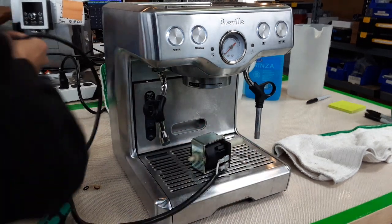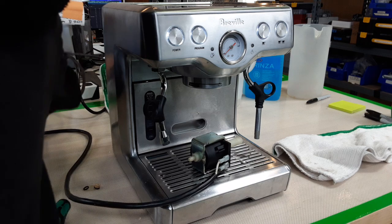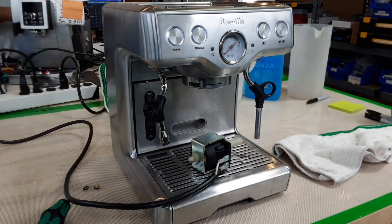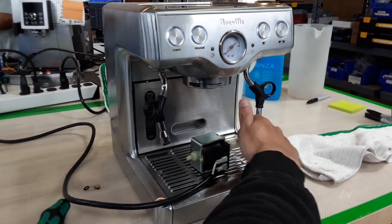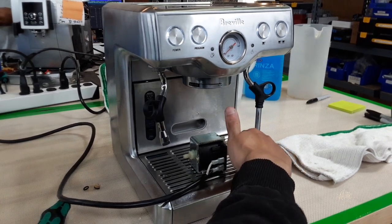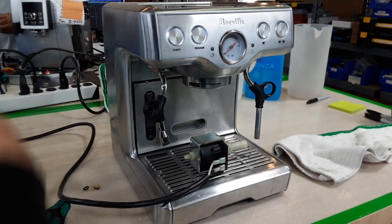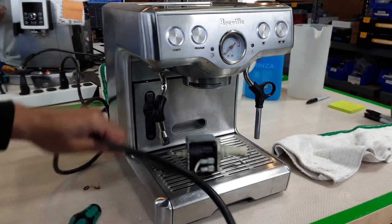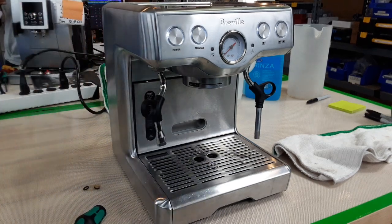I'm going to put this in view so you can see it. You usually don't want to touch pumps directly once you plug them in. As you can hear, nothing's happening. Usually a water pump doing this test will start vibrating because it's trying to pump water, but this one is not doing anything at all. It kind of hums and vibrates slightly — you can feel it by touching the plastic part — but it is dead. So we put a new water pump in, and now we're set to test.